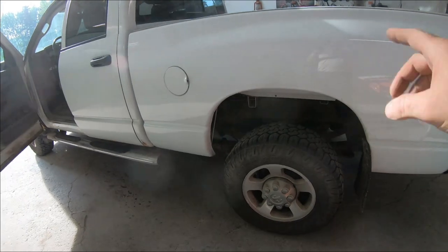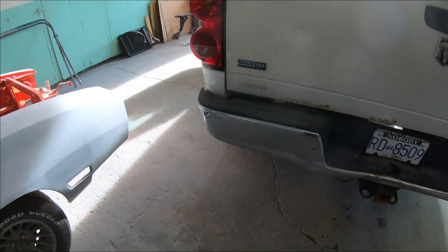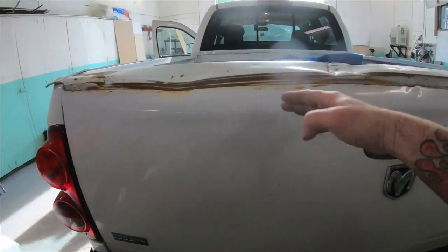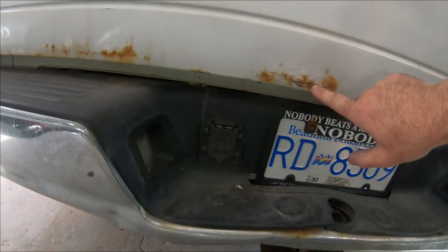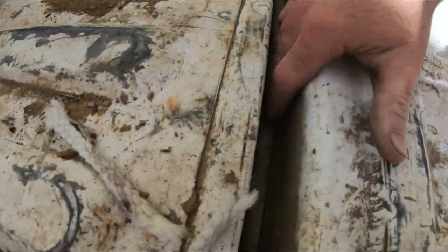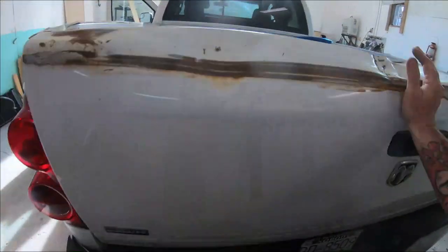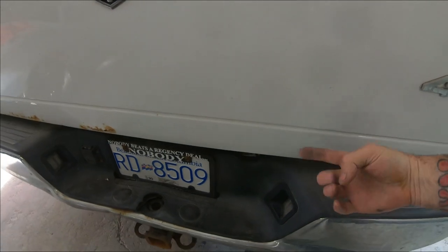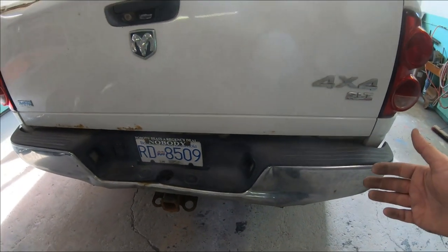Initially this job was four bedsides fixed in the box, but now that we're doing the rest of it we're putting a new tailgate on as well. I just ordered that yesterday. Down here on the tailgate you can see it's rusted through. The best thing to check on these is the pinch weld — when that's all swelled up, your tailgate is garbage. You could put a bottom on it, but again it's just no point.